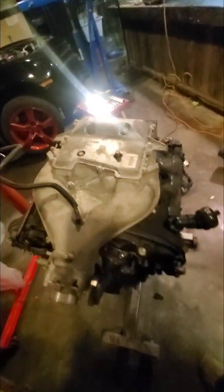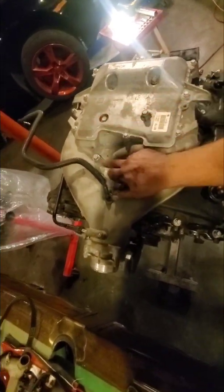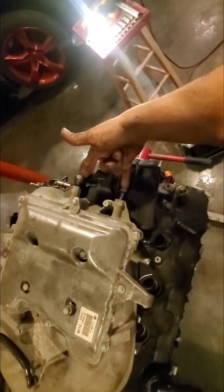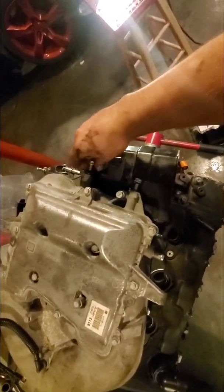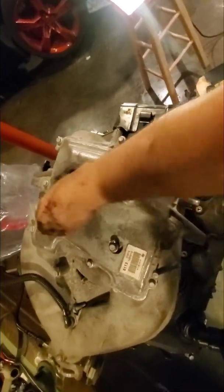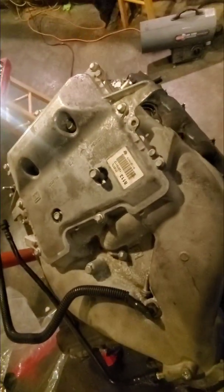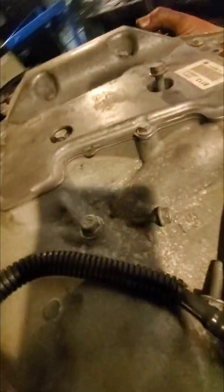So this is virtually what you have when you go ahead and look at your car. This is pretty easy to take off — there are one, two, three, four, five bolts on the top and then two on the back holding the plate. To save time, I already took all these out. This cover is going to stay on here when it's in the car. So what you'll do is pull this up — it's a little hard to do one-handed. Pull the cover or intake off and set that to the side. This is what you're going to basically see underneath.